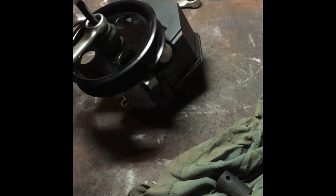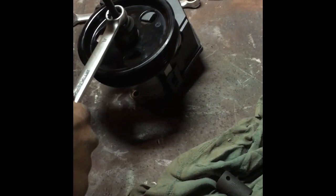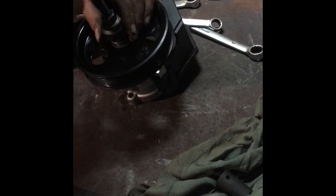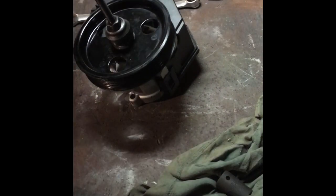The camera's shaking because it's clamped to my temporary workbench — it shows you up close and personal what you need to see. And I think we're pressed on. Take your end result — spin your tool out. Not quite there yet, so we're going to spin the tool back in until it bottoms out, then back it off half a turn — just enough so it's not bottomed out and you're not going to damage that shaft. Lock it back down. Back to it, working on pressing the pulley.